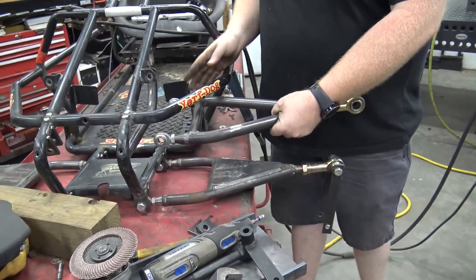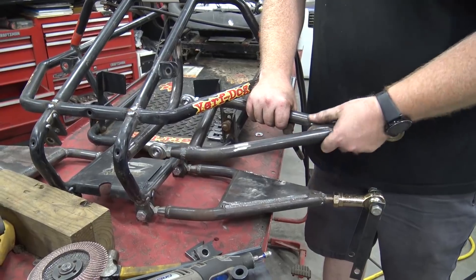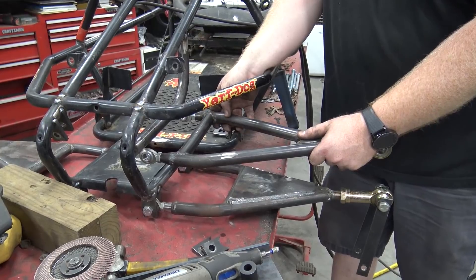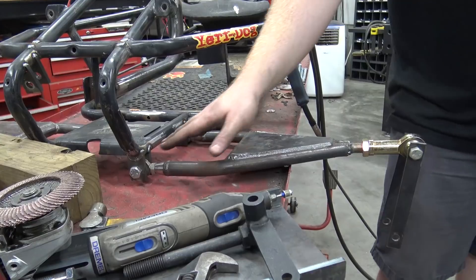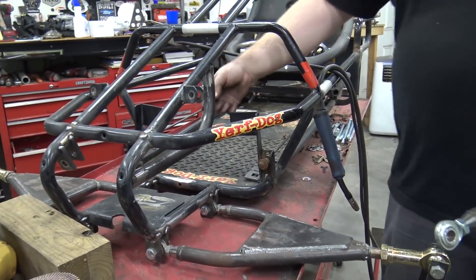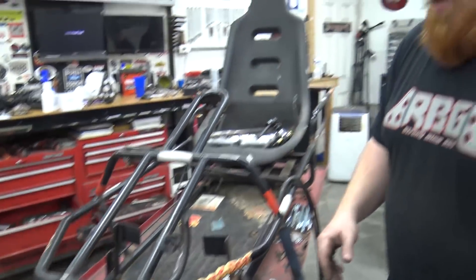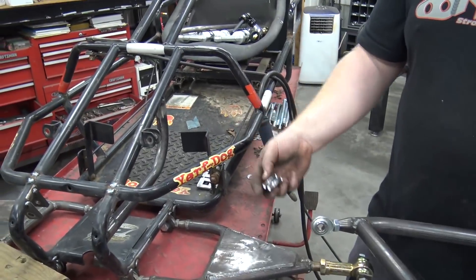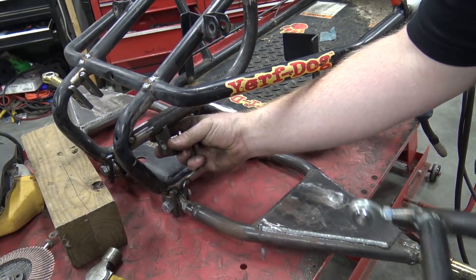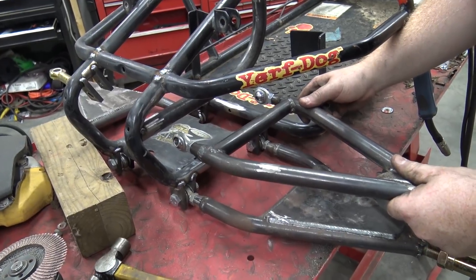I'm using the original upper and lower a-arms. Normally I would just put a pretty decent gap between these, but this go-kart isn't going to allow me to do that. So what I'm going to do is put ears and put the a-arms about that far apart. You saw us put these tabs on the bottom - now I'm putting this piece of tube in, and I'll do another one on the other side and brace them to one another to make it all strong. I can weld tabs directly to this that'll hang the a-arm down, so the a-arm will be not a ton of space - about like that.